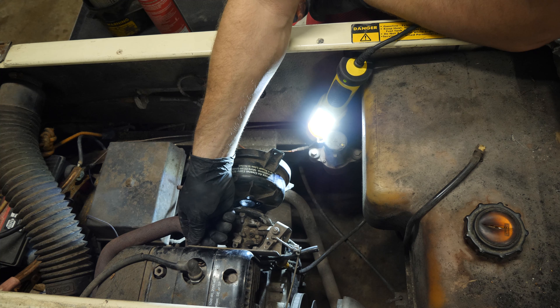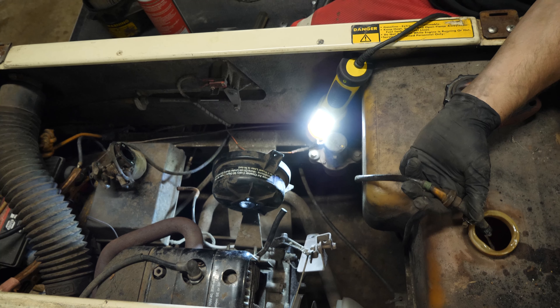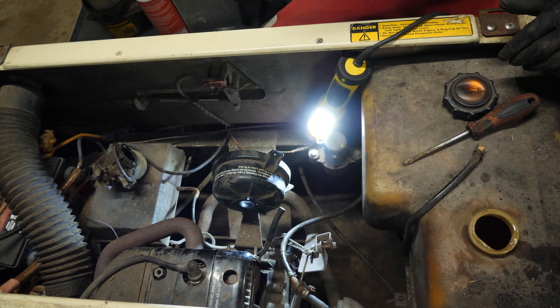So there definitely is a lot more stuff to take apart on these older carts in some cases. We're gonna replace that fuel filter. Fuel line comes right off. I'm wondering if our electric fuel pump died — I'm gonna check that right now by turning the key on. No, there's fuel there, so I don't really think that's our problem. Our electric fuel pump is working just fine. That is definitely not our problem. So it's definitely gotta be in the carburetor.